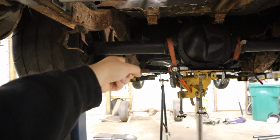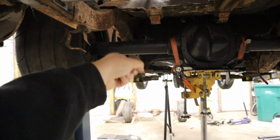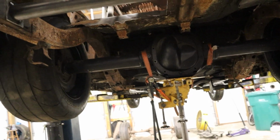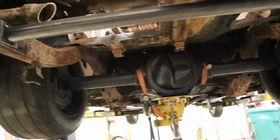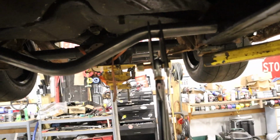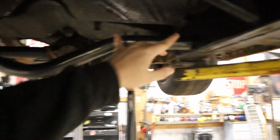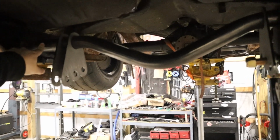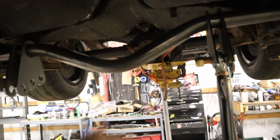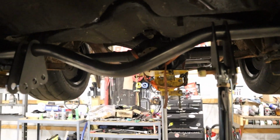Basically going to bend some bars that go from just inside the frame rail over the axle to this. More or less, that's what we're doing. Up above the axle, we're going to have another cross member for the shock mounts and to help with bracing. And I'm going to make a couple little pieces to help triangulate the frame and everything up here. And I'll do some more in the back and some just here and there wherever I think it needs it.